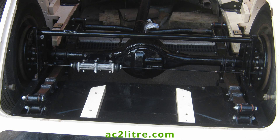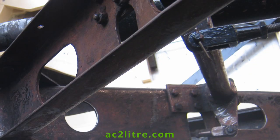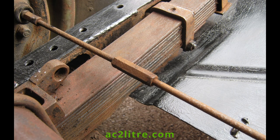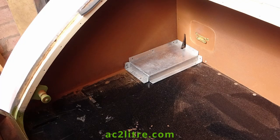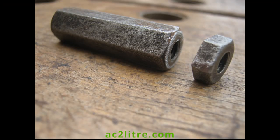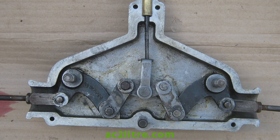Next we move to the rear axle and the rods that run between the compensator and the wheels. Disconnect the rear cable from the large cross shaft. If your AC is fully assembled it can be awkward to access the adjusters on the rear axle; early ACs have access holes for the lever arm dampers which helps. The adjusters are long barrel nuts. Be careful not to confuse them with the shorter barrel nuts that connect the rods to the expanders at the wheels. Slacken the lock nuts at each end of the barrel nuts, remembering that half of them have left-handed threads. With the brake adjusters still locking the shoes against the drums, adjust the rods to take up any slack. The lock nuts on the rods should be flush with the ends of the compensator casing. Tighten the lock nuts on the barrel nuts.